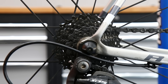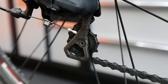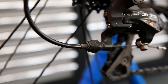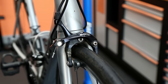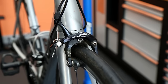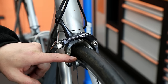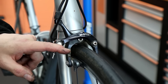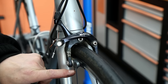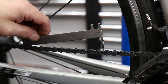You can see here how the grease and grime has built up on the boot set itself — it clearly needs a good cleanup. The thumb adjusters are quite corroded; there was a lot of corrosion on this bike. The front brake was not central to the wheel, so you can see how that's pulling the wheel across towards the fork. That would put strain on the bearings every time the bike was braked, so we need to make sure the brakes are on square once it's completed.